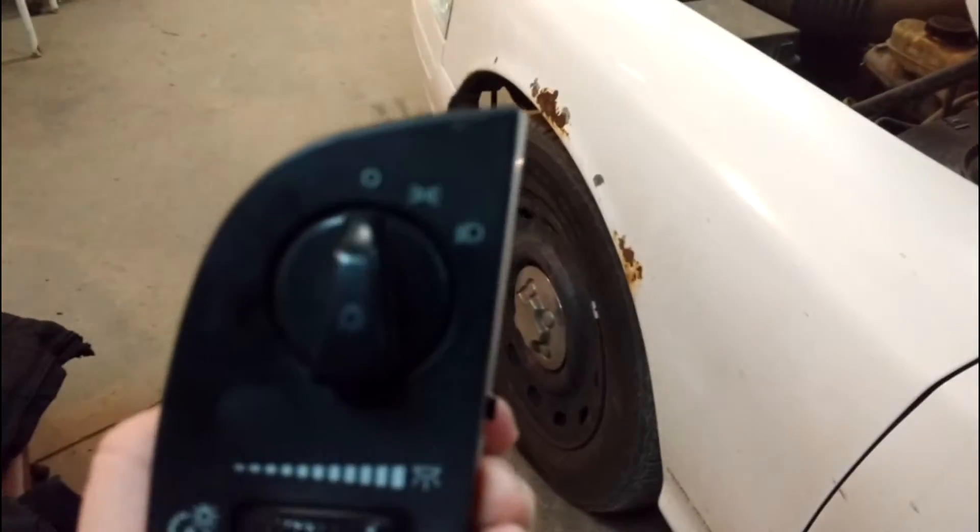I just tested and the green tint is on the inside of the housing here. I've seen some where the bulb has a green covering, but it's actually tinted in here. So I'm just gonna go replace this with a white LED and a resistor so it works at 12 volts properly, and plug this back in so my lights aren't on — even though they're LED — I don't want to drain the battery unnecessarily.